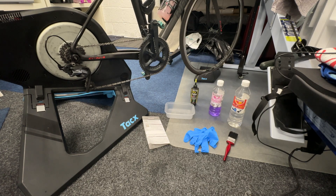Pour away the white spirit, then do the same thing with methylated spirit — submerge the chain in it to remove the residue left by the white spirit. Agitate again with the paintbrush, then rinse off the methylated spirit and let the chain dry.